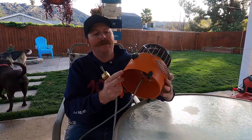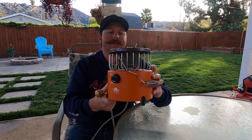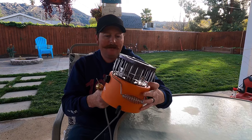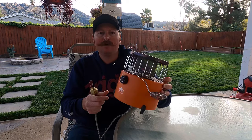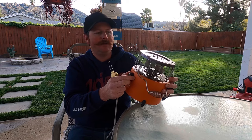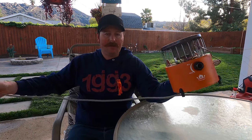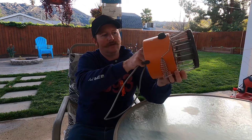This is the camping gear two-in-one portable propane stove and heater. It works as a stove — it came with a little pot and pan combo. We tried it at home and it worked really good the first time. It has a knob that goes from minimum to maximum to regulate the fuel, so you can turn the heat up low or high. It has a hose with an adapter that connects to a one-pound propane tank, and it also comes off so you can use the small canisters that screw right into the bottom — so you don't have to deal with the hose.